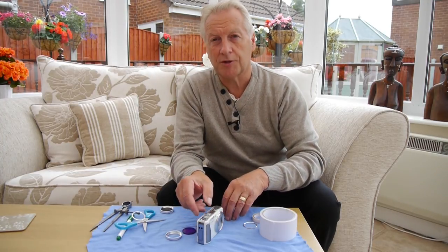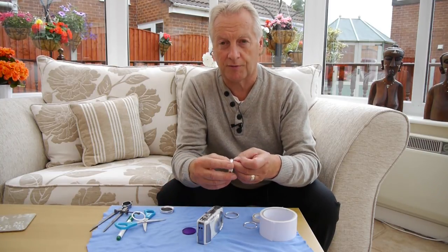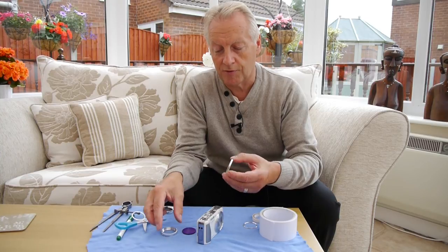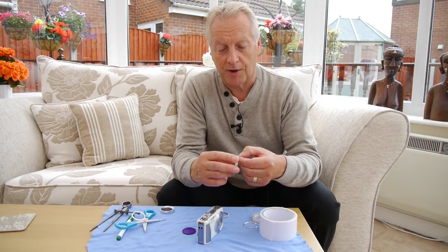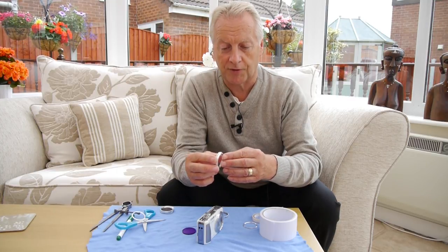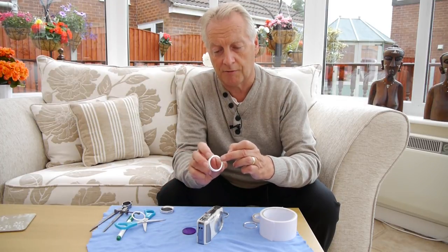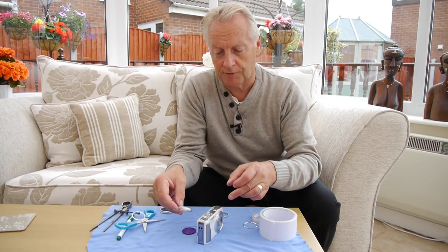In my original prototype I decided to remove the rear threads of the 37mm filter to give me the slimmest possible filter mount. If you don't have the facilities to do that — I used a Dremel, a file, and then smoothed it down with carborundum paper to get a really flat surface — then you can probably still use this 37mm threaded ring at the back, which will give you sufficient area to bond to the front of the camera.